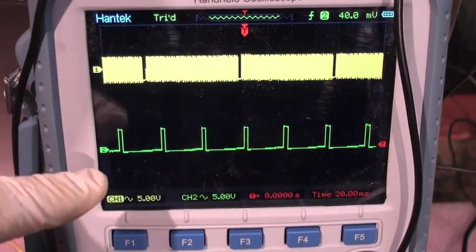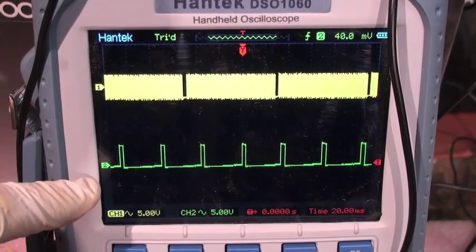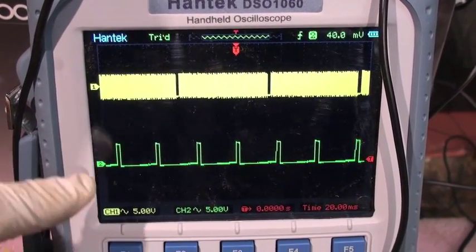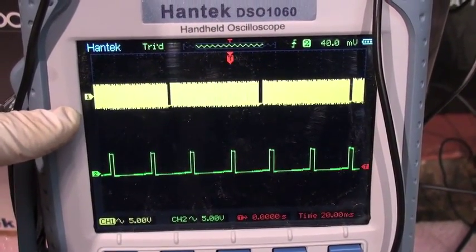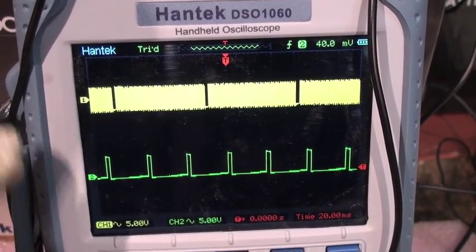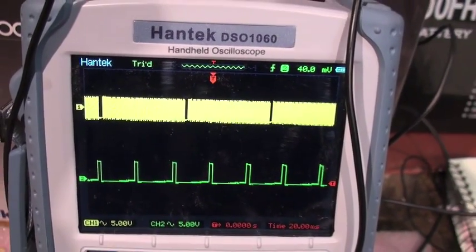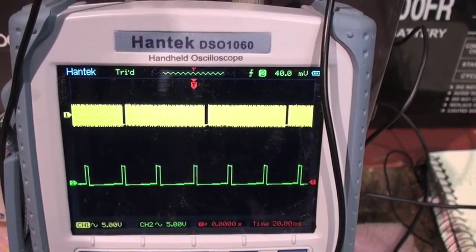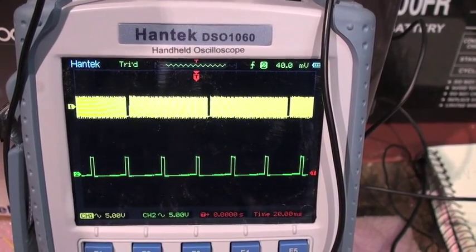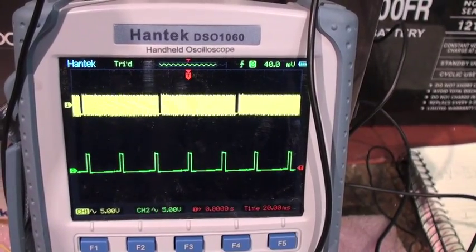So what we can do now is I'll have a 2-pulse input on the end shaft of my motor. And as my RPM goes up and down, it will actually tell the Arduino to put out the 58-2 pulse in proportion up or down. And it will make the DME in the vehicle think that the motor is running appropriately. This is James from North Mississippi.